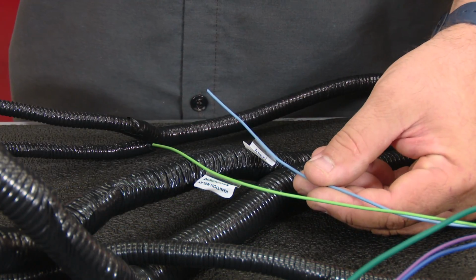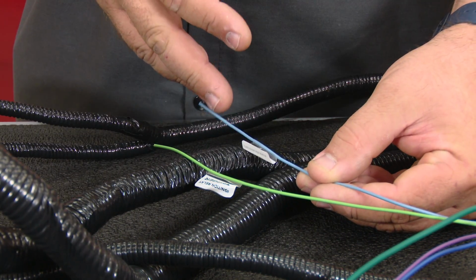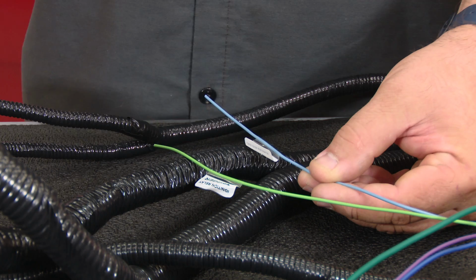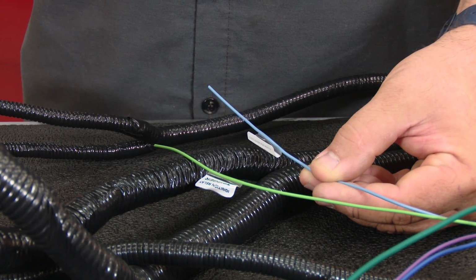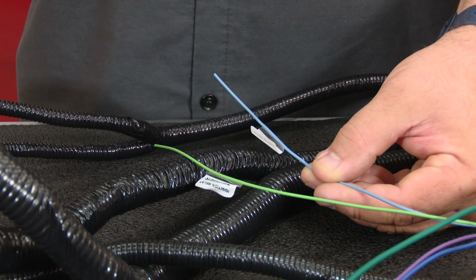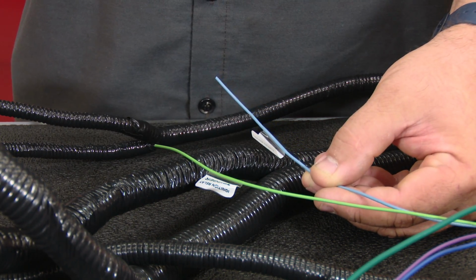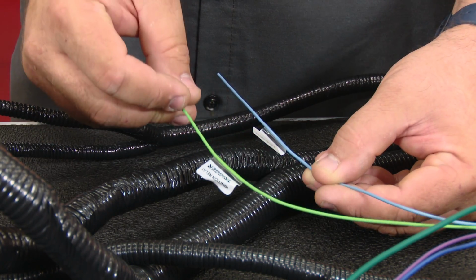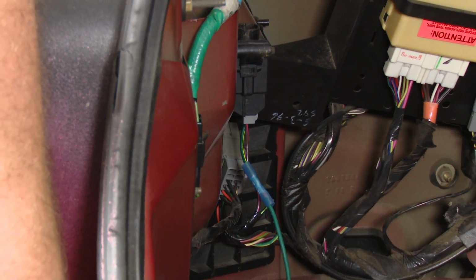The light blue is kind of the same idea, but not the same. This just needs to get starter motor request. So this needs to have connected to a point where you get 12 volts when the engine start is asked. So when the car goes to the start mode, this has to have 12 volts. Not necessarily when the run, but just when it goes to start to make sure the starter motor engages. So again, this one you need for start and run. This one, start only.